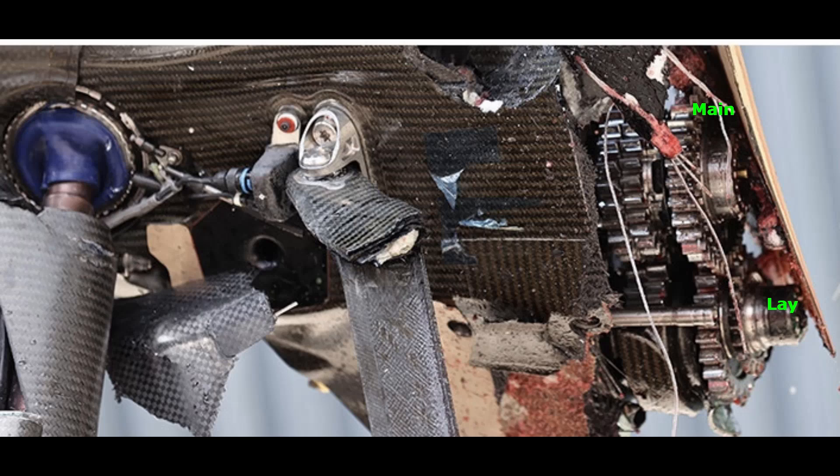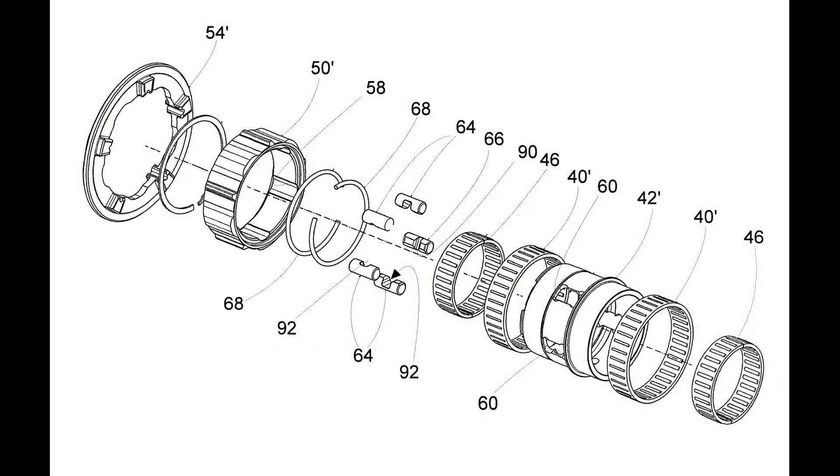The reason I can tell that is because I can actually see the hub collar here. What this means is that this large diameter of main shaft indicates there is some sort of clutching mechanism inside the main shaft itself, which is extremely important. Everything I've heard about the current era of hybrid F1 gearboxes is that they can actually select two gears at once, and I've seen numerous patents from X-TRAC and some of the other producers of these motorsports gearboxes that show some of these different types of clutching mechanisms.